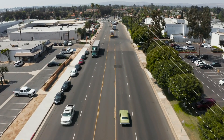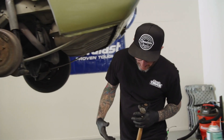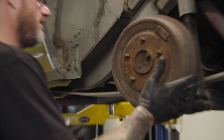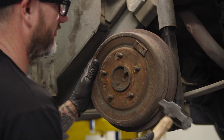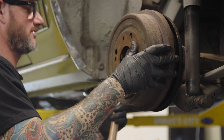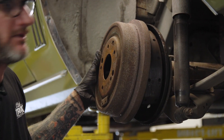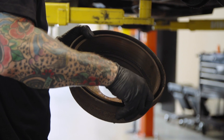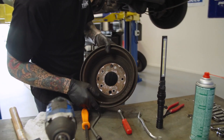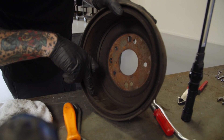Taking it out on the first drive, one of the things that stood out to me were the brakes. The drum stuck a bit, which could mean a couple things — one being the shoe has worn a groove in the drum, not allowing it to release. And yeah, this thing is all grooved up. Look at this compared to the front one that was all smooth — it's got a lip right here. That's what everything was catching on, that little lip right there.